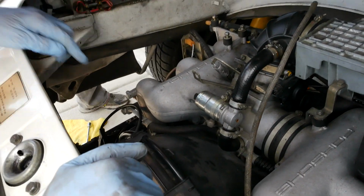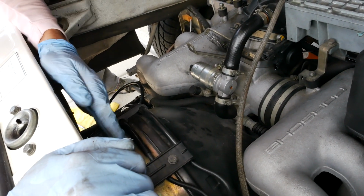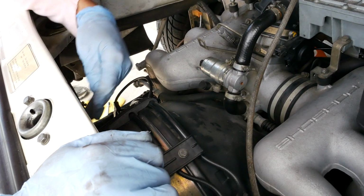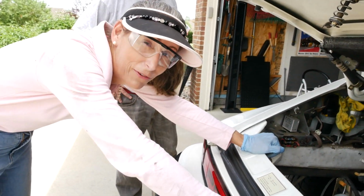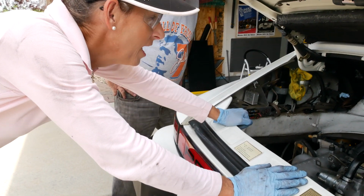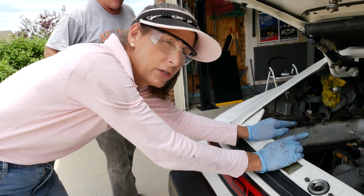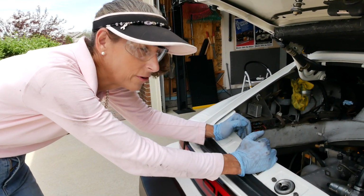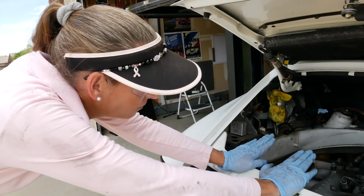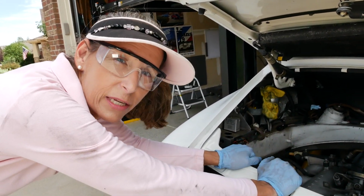So this was our problem. We had the belt stuck up here, and it actually put a little bit of a dent in this cross piece here, which we'll have to bang back out. Not the end of the world, but these sorts of things happen when you've never really done this before. As Doug said, it's kind of a strange thing. The problem was that the shift shaft was still stuck inside the tunnel, but we couldn't get the engine back any further. So we ended up having to jack up the front, the transmission mount a little bit, which tilted the engine back, which got us out.